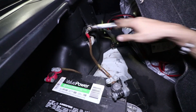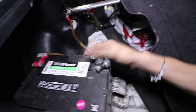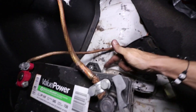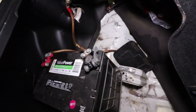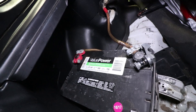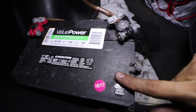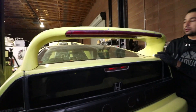That's what's feeding the inside fuse box off of that little wire coming out of the fuse holder. That baby one — and then where's the rest go? To the starter? Yeah, so that's main power for the starter. Did you see the ground though? They ran the battery to the ground. Let's go look at the ground. Oh, that ground's epic. It's on a painted surface too. They have a floor board. They got the whole bracket to mount it and everything. It came out of a truck and it's still not holding. They put a screw right there just in case. Very nice. That battery's made in Saudi Arabia — it's meant for like a truck. 730 cranking amps. It's a 2017, it still has warranty — from Walmart! We can take it to Walmart and get a new one.